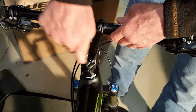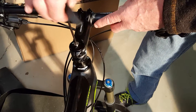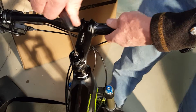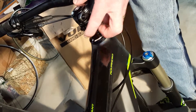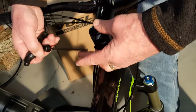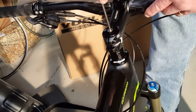This is called simply a cap screw. You take a three millimeter Allen wrench and you tighten it up — get it snug. You don't want it real tight, but you want it snug. By tightening this cap screw it cinches up the handlebar to the fork. Initially, until you get the wheels on, you just want to tighten this just a little bit so it stays together. There are two screws — one here and one here — and this does not have to be tight, it just has to be snug.